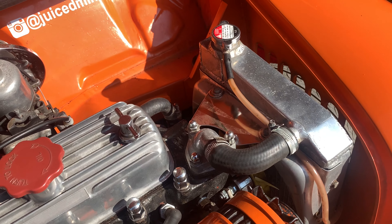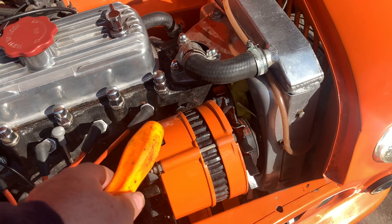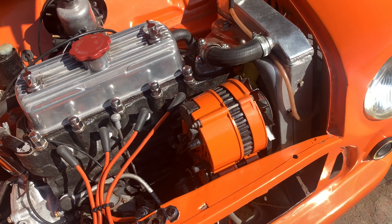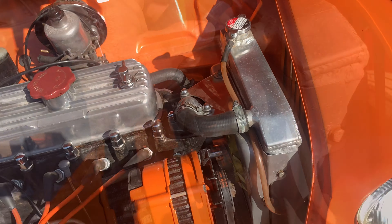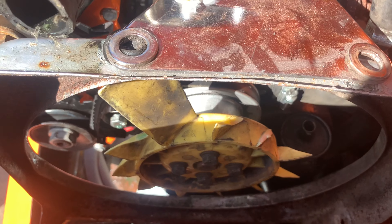On to the Mini now — I'll go and get it. We've got the Mini round here, still didn't put the grille on from last time. First job: drain the coolant out, because we've got to take the radiator out to change the fan, and then tinker with the alternator because it's not working. I've taken the top rad hose off, now I just undo the four bolts holding the shroud on and the two at the top from the bracket — and there is the fan blade.